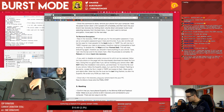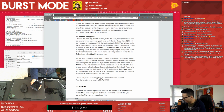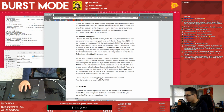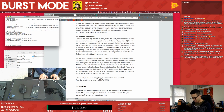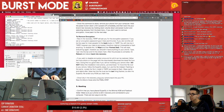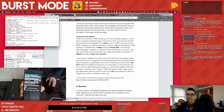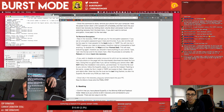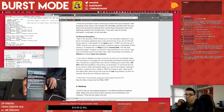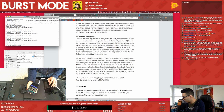Right. So now that the device is off, we just have to do the same thing again. No big deal. We just had to make one small adjustment, and then we're in good shape. So now that we're back here, let's run fastboot devices and make sure we see it. Cool. Fastboot flashing unlock. Okay, success. Almost every single device will give you some sort of a prompt like this, warning that this could really mess up your device. Be careful. And that's okay. So we're going to say yes, unlock the bootloader, and wipe the phone.